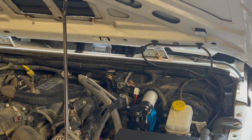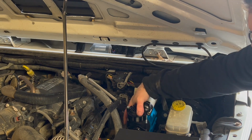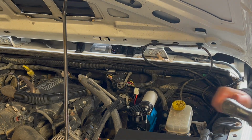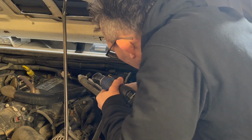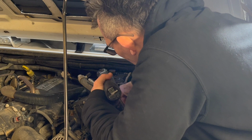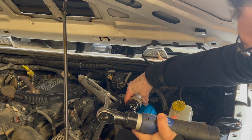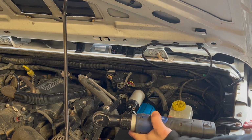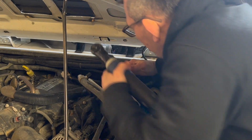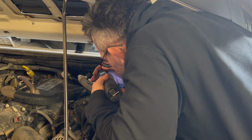Now that I got that all tightened up, I'm gonna move the compressor by sliding it, like I'm gonna rotate it over. That way I can get the cylinder on the other side and have more room for all the solenoids. Now there's these 2 little Allen heads that clamp down on the center section. And all we're gonna do is just loosen both of those a little bit, and then the whole pump will actually rotate. Now I'm not gonna go too far. I just wanna have enough room for the 2 solenoids that are gonna be for the lockers. I'm just gonna snug those clamp nuts back up.